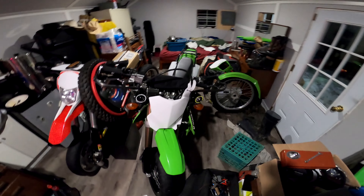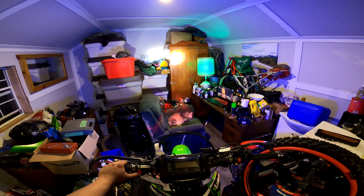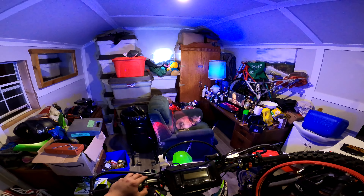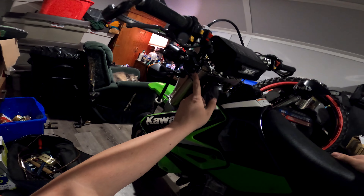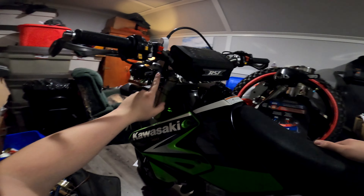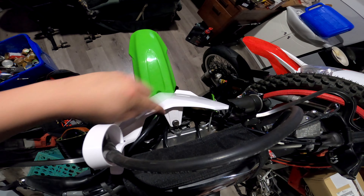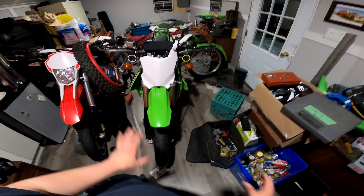After spending all that time setting it up correctly — well, it is what it is. We get some good light, switch it off, back on — that's like a low beam. You can see a red light and there's a strobe feature — one glows blue and the other white. Chinese junk. So we've kind of remounted the hand grip warmer module to also work as a bracket for the light. We had to custom make a little 90-degree bracket for the triple clamps.